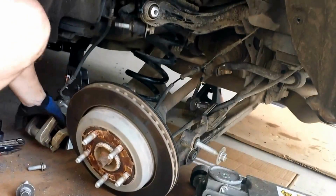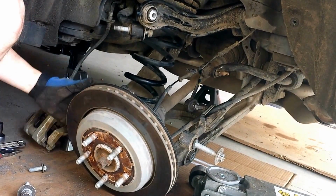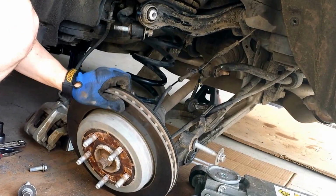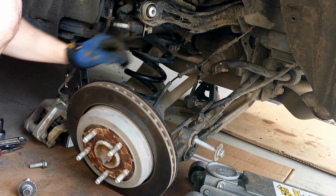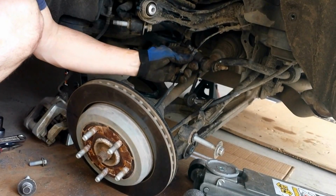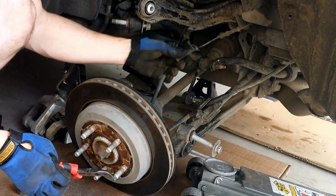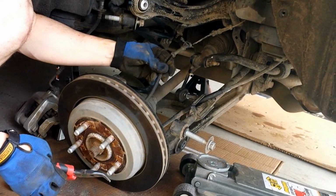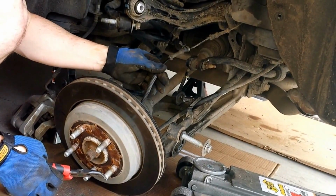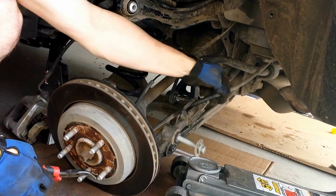I took off the rear caliper, pretty easy, 2 bolts, just so I didn't have to stress this cable anymore, stretched over here, because when I was getting down this far, the cable was tightening up. Last thing I want to do is break that. Another good thing is to take out these speed sensor cables. I found that this type of pliers work best to get in and pull that off. I don't know if this is a speed sensor. I think it may actually be the air pressure system. Rear brake, parking brake, plenty of room on that.